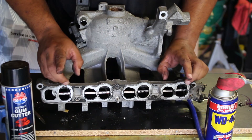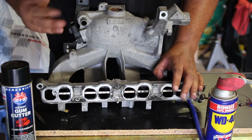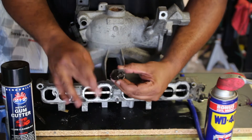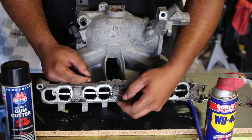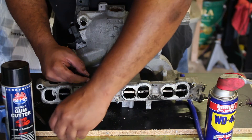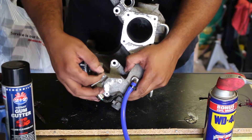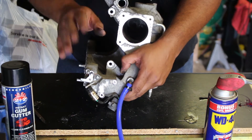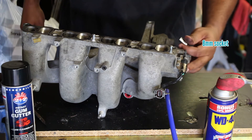When drilling the screws out, you really just want to get down into the head of the bolt and then you'll see it start to spin and come off. Once that's done you can lift the plates out — you will end up with four of them. They've got a little bit of an oil coating from the EGR and PCV setup, which I hopefully fixed with the PCV plate and oil catch can. Next, to take the rod out there is a nut you have to remove, and once you get the retainer out of the way you can slide it out. You'll need an eight-millimeter socket to get that bolt out.